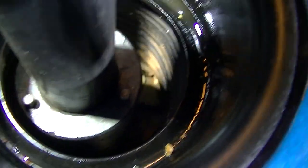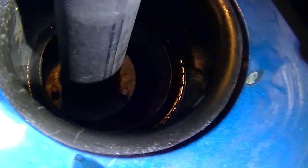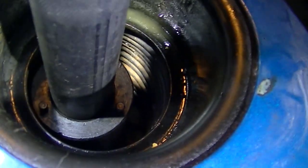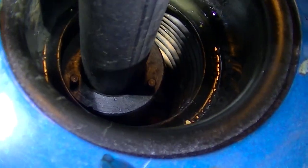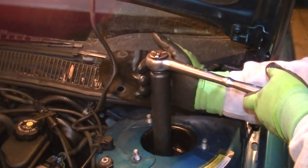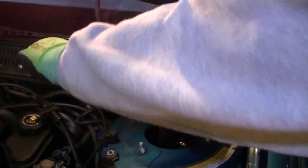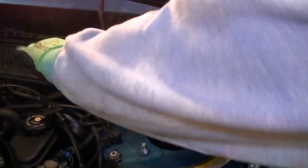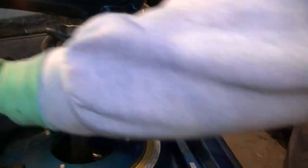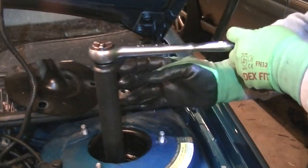There is the tool — just drop it in, drop this part on it. Now we know our pins are locked onto the collar around the top of that strut. We started with the tool and an 18-inch breaker bar, and now faithful assistant Beaker is using a ratchet to pull it off the last couple of turns.